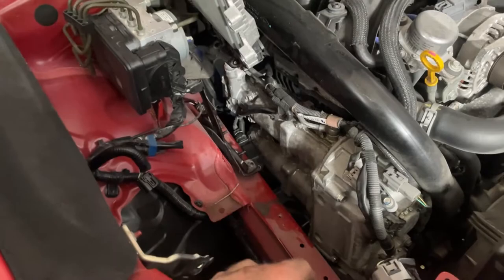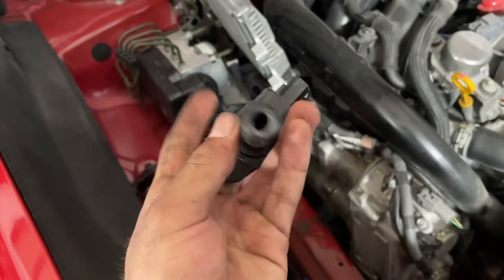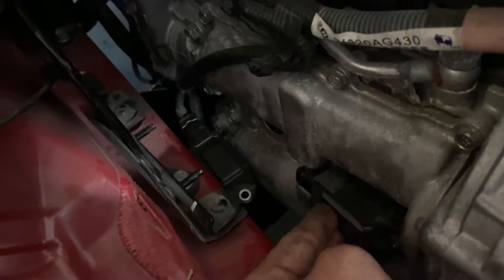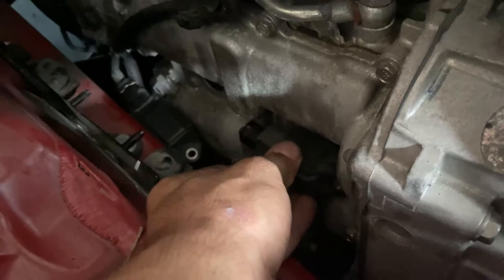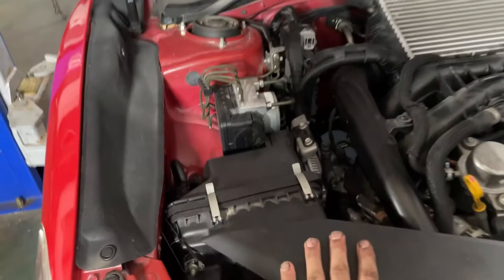Now we reassemble everything. The coil packs go back on top of the spark plug - make sure when putting it back in that you feel the tip of the spark plug start to guide into the hole, otherwise it'll jam up and not give proper spark. It should just slide right in without force. One way to confirm you're on correctly: if you pull it out it should make a nice pop sound, because it has a little bit of suction when pulled free.